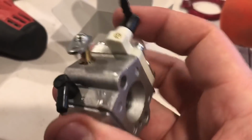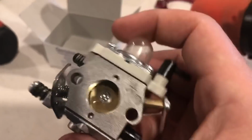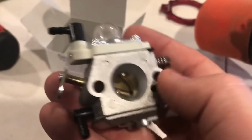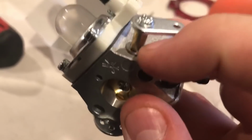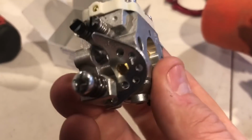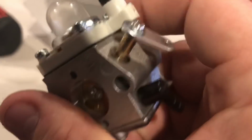Oh yeah, before I forget, I was going to mention this to you earlier when we were talking about 990 carburetors. You want to get the one they call a modified carburetor, but it's not like a modified rooster tail. It's not ported, it's not polished, nothing has been bored out. It's just a performance 990 carburetor. The reason they call it modified is because they drill this out and they put bearings here. That's what you want.